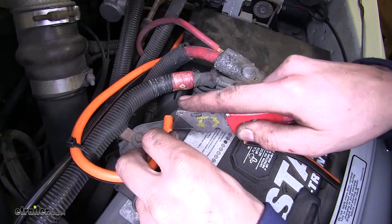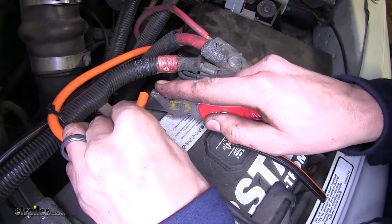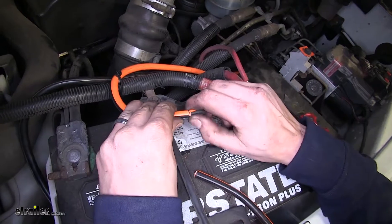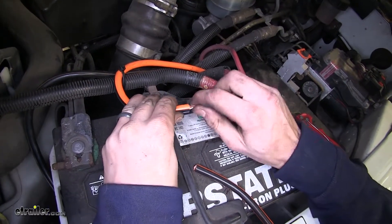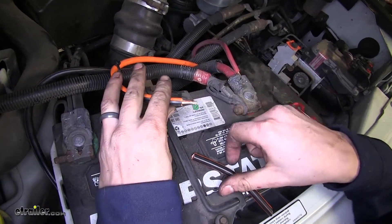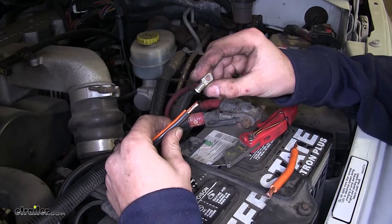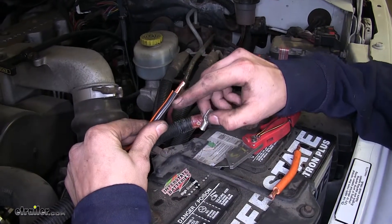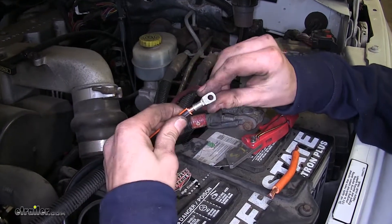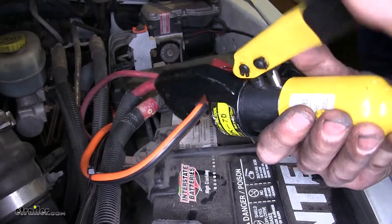Just using a utility knife to do this. If you have wire strippers that are big enough to do this, that's good — I don't, so I'm just using a utility knife. Now that we have it cut, we'll pull off the end and we'll twist the wire together nice and tight, and we'll do the same for the other two ends. We'll take one of our ring terminals that comes with our kit, stick it on the long end of our cable all the way down, and we'll crimp it into place. We're using a hydraulic crimper for this, which is readily available at most hardware stores.